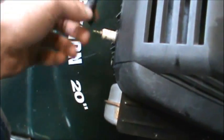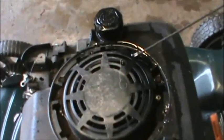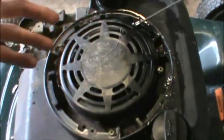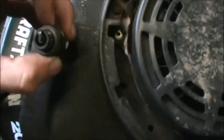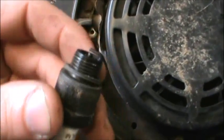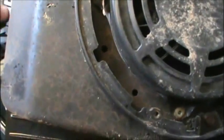The next thing I'm going to do is yank these two Phillips head screws off, just to get a look at what's going on underneath the cover. This is just a plastic cover to keep you from hurting your fingers. I'm also going to take this spark plug out — that's just your coil lead — so I'll get a spark plug wrench and take this thing out. I took that cover off the top to get a look at what's going on. I also took the spark plug out to check if it's fouled. A lot of times you can get fouled spark plugs — somebody will run two-stroke oil in it and eventually foul it. This one looks pretty black; it might still get spark — it's a questionable spark plug.